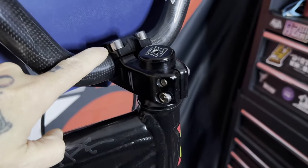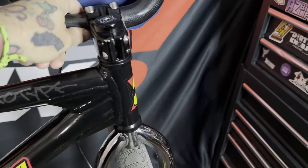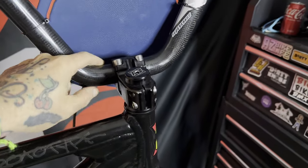The other thing you want to note is it does have a thicker clamp diameter here on the bars, so you want to make sure you get the Speed Line stem that matches the OD — the clamping area. It's 31.8 — I forget the exact size but I'll put it down in the description. It's just a bit bigger than a standard BMX stem clamp area.